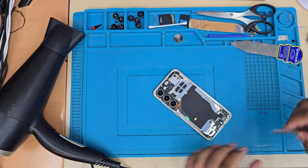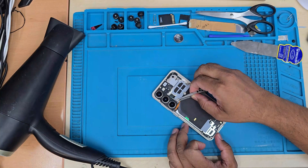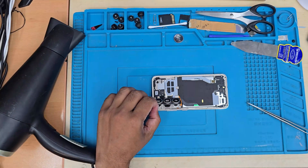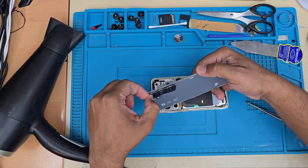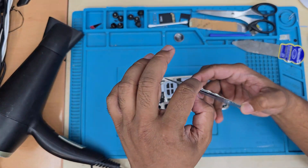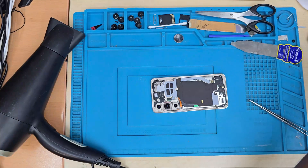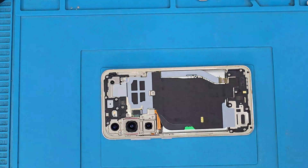Here is the camera lens — we need to take this out too. I'm going to use my tweezers. I applied enough heat, which is why the lens came off completely. There is strong adhesive; I don't need to reapply it, I just put it back without touching the actual lens itself. We keep it in a pouch so it stays dust-free and we can reapply it later.